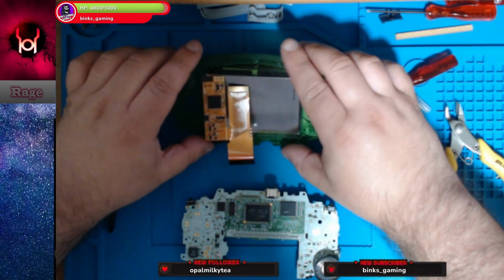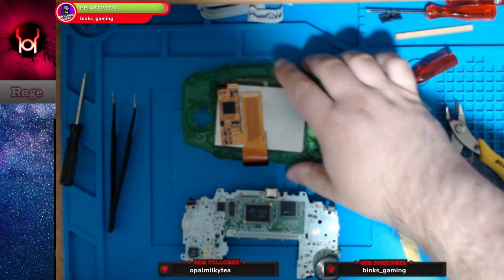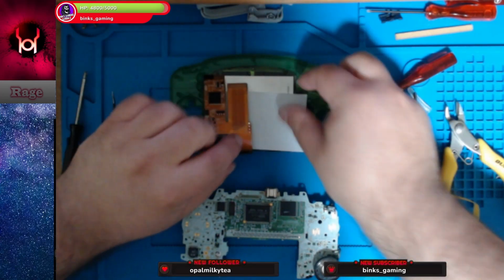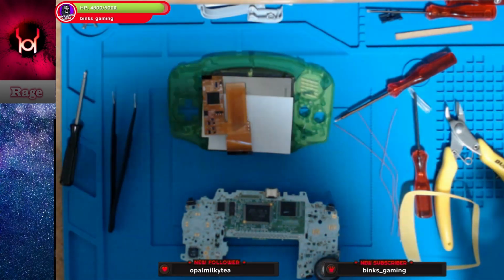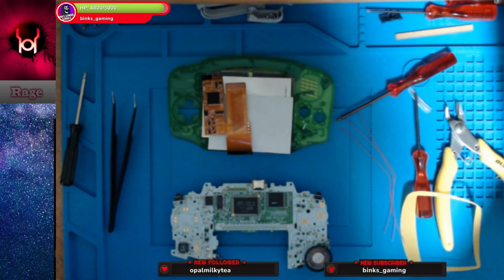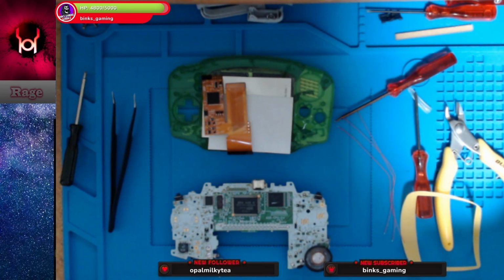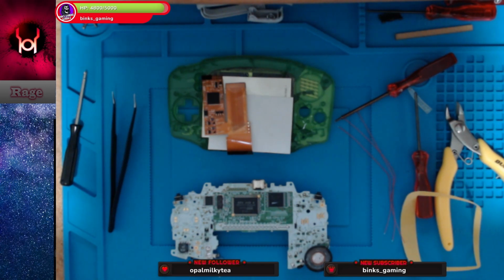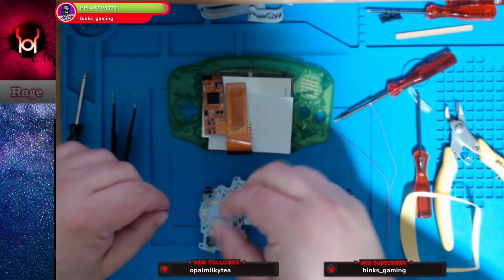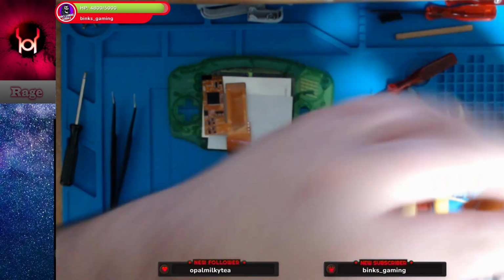I don't want to take this off. So I'm going to be ballsy as all hell and solder right onto this thing. But what I will do is put something under, because soldering onto that screen is not a good idea. Now TP2 I believe is select. I'm going to double check that quickly. I'm going to mute this so you don't hear it. Yeah, TP2. So one of these goes on TP2, which is the one that goes to the select port. Now TP2 does not have solder on it, so we'll put some solder on it.